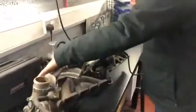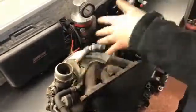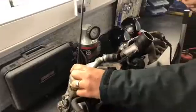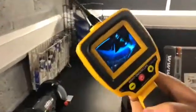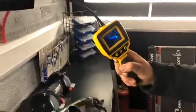The only way to get in and look at the impeller housing underneath would be to actually remove the compressor housing. Now what we'll do is try and show you a good turbo. As you can see, all the fins are in place, everything looks nice — that's in really good condition, absolutely fine in there.